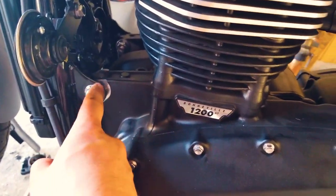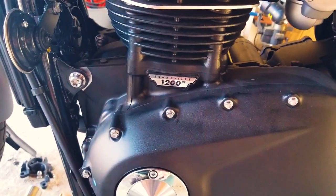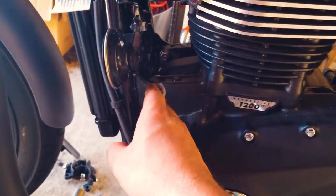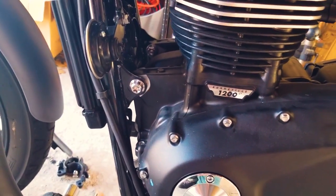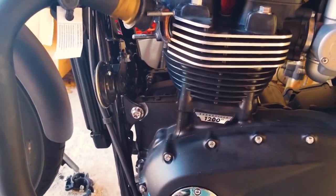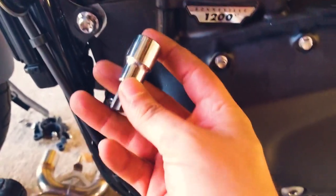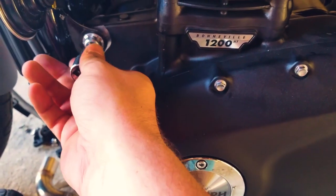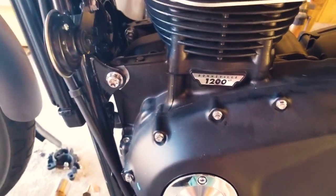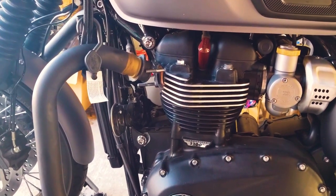You'll need a serious wrench for this. I think it's around 80 newton meters — don't quote me on it, but it's on tight, really tight. I couldn't crack it with a smaller hand wrench. I ended up using a big torque wrench and it's got so much leverage it's fine. Also be aware of the torx bits — for this engine mount it's a big torx, T55. Just be mindful of what tools you'll need. Anyway, I'm going to get back to it and hopefully get this cross pipe on today and fire the Bonnie up to hear how it sounds.